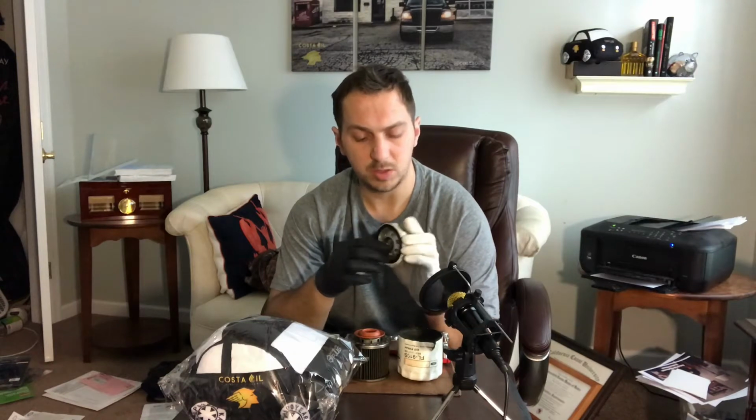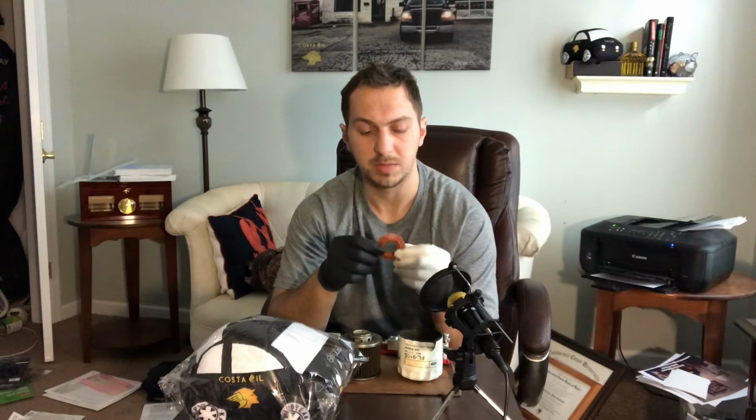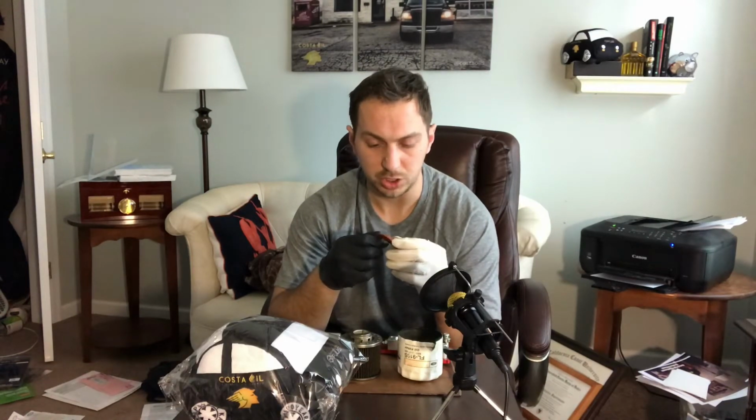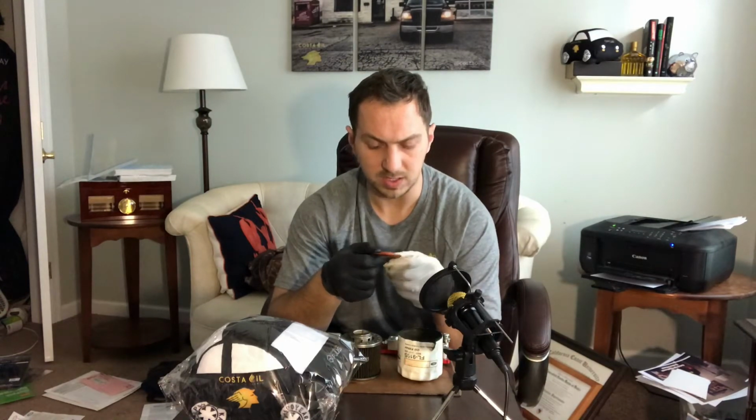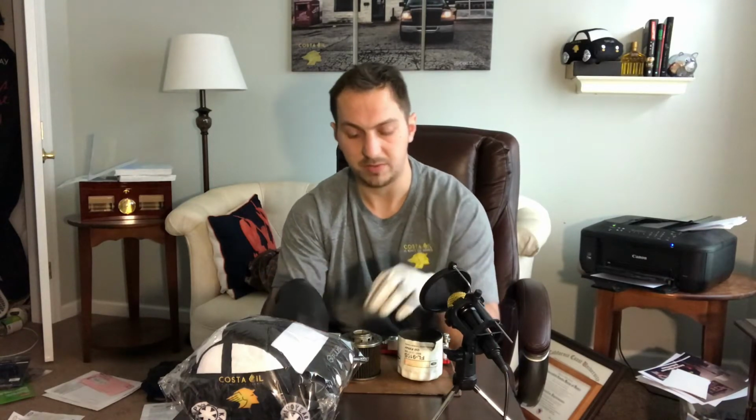So this is a steel base plate on this Motorcraft filter. We move into the filter. Usually there is a drain back valve. This filter has a drain back valve. It's some kind of silicone based. It's in good shape. This is the original Fomoco Ford Motor Company anti-drain back valve.